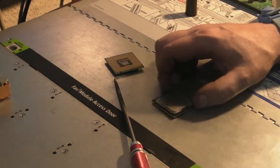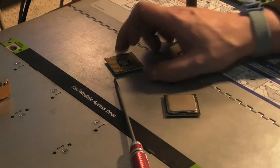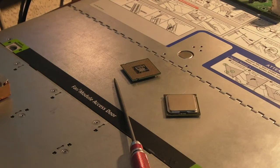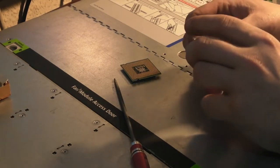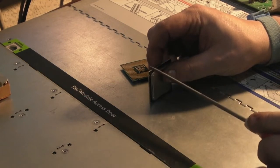Right, so in theory, where I've got them two marks there and there on that Xeon processor, if I file a little bit away like on that, then that processor should, in theory, fit in the socket of the motherboard that I've got over here, which I'll show you once we've actually filed this away and we're going to actually do a test fit. So, this is the moment of truth. We can't really go back now. What we've got to do is basically using the file.